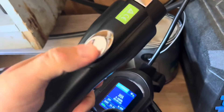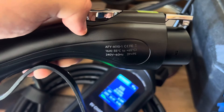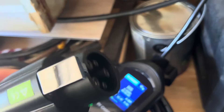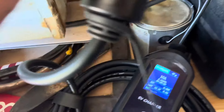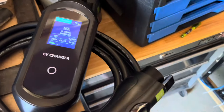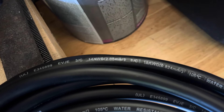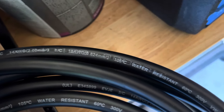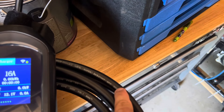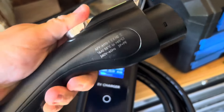Looking at the charge handle — it's plastic with a plastic button. This specific unit, the FE-110-TAC-1, is specifically only for 16 amps, which is good because the cable won't handle more. The J1772 handle and wire look decent. This is 18 gauge for your grounding and communication lines, and 14 gauge for your main connectors. It's rated only up to 300 volts — the manual's three-phase 400V option obviously uses a different handle overseas.